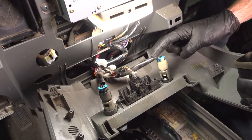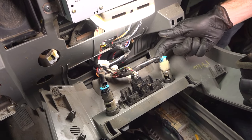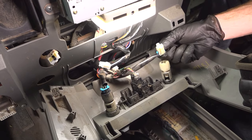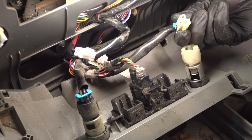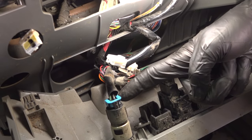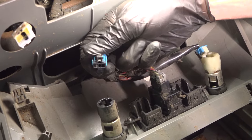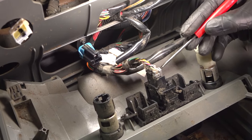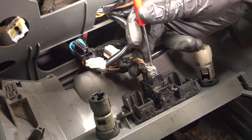Let's reach down in here and start disconnecting these. For each of the power outlets, you're going to find that you have a small connector lock down along this area. Just get right on it, squeeze it, lift it up, and give it a quick inspection. Here's the tab that I squeezed from underneath, right where my index finger is. I'll do the same to the other side and then move along to the center. For the center, we'll use a small pocket screwdriver, coming along the passenger side where you're going to find the locking tab. Gently get in between there and pry it up.